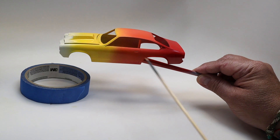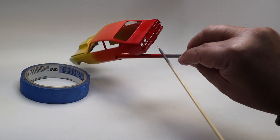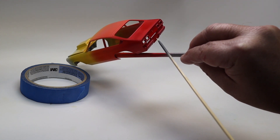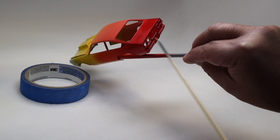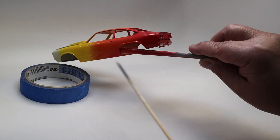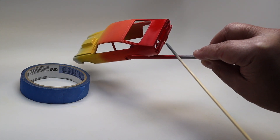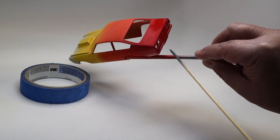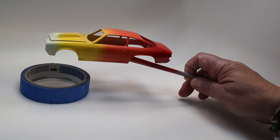This part came out okay, but not in the back — because what I had done was I had washed the vehicle with warm soapy water, and I used the hairdryer to dry it. But just when you thought everything was dry, it wasn't. So we had some beading back here and the primer showed through.